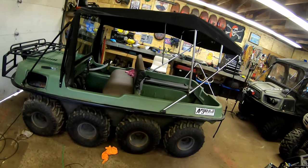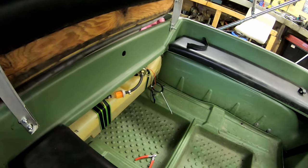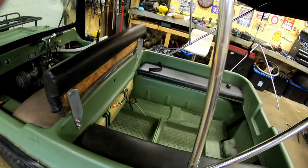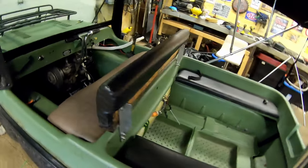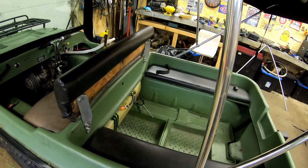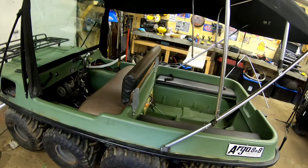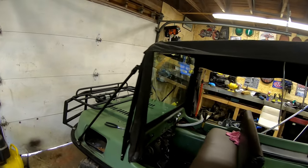In terms of the electrical fuel pump, you can see that's plumbed in. I've got to tidy up the wiring. It's actually on quick disconnects, so all I have to carry is the spare pump, which I'll probably put underneath the new flip seat, and a screwdriver. So if I lose my fuel pump in the woods, it might be one or two minutes and I'll have that swapped out with another one. But I'm certainly moving along.